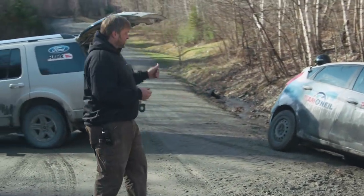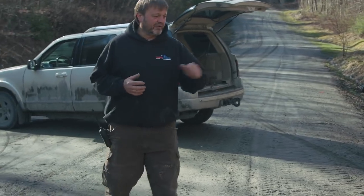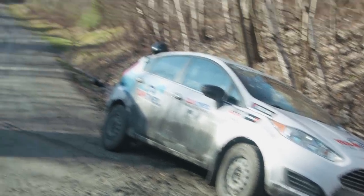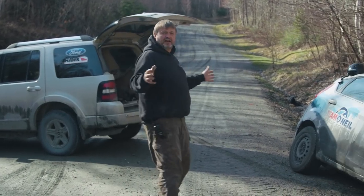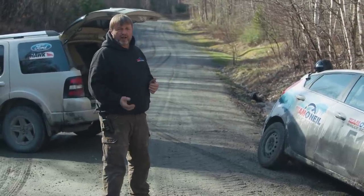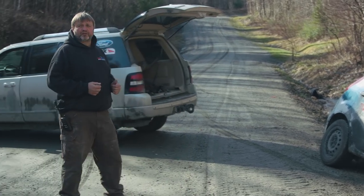If you find yourself in a ditch and we're going to recover this vehicle, I can't really go ahead because I've got a culvert here. It's kind of downhill, so I'm not going to pull them straight back up the hill because I want to get them out of the ditch as soon as possible. One of the things people make a big mistake is they just think in straight lines and they'll either pull them straight down or straight back and it never really comes out of the ditch. So I'm going to grab them at a little bit of an angle so that I get the back end of the vehicle back up on the road first.